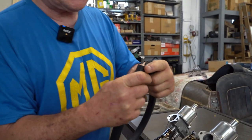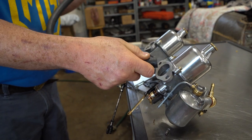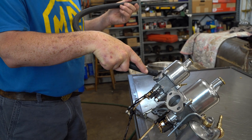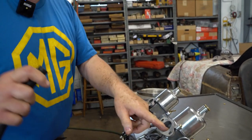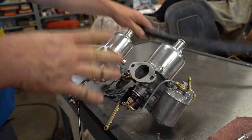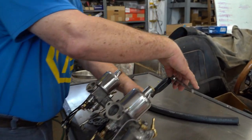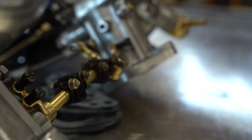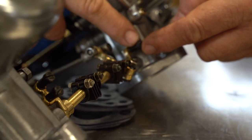What I prefer, because I still have reasonably good hearing, is to let this hose stand proud of your finger and put it in the throat so you're testing the same thing each time. You don't just do this casually, because here you might have it half an inch in and over here an eighth inch in, and the hiss is going to change. You listen to the sound. One is drawing more, so you increase this by a turn, decrease that by a turn, check again, get them closer and closer until finally they're both drafting the same amount. Then you lock the carburetors back together, and any future adjustments you make an equal number of turns on each screw.